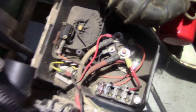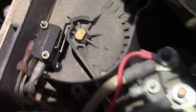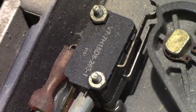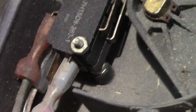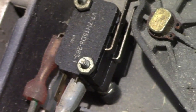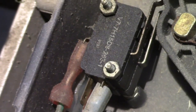Alright, we've got the cover of that fuse box removed and we can see our micro-switches right now. Just going to zoom in on them — there are just two small machine screws holding them on. You remove those two nuts, and I would recommend that you remove the top one first, then unplug these wires one at a time and plug them into your new switch as you go along, that way you won't forget which one goes where. So we're going to take the nuts off, remove that top switch, unplug the wires from the old switch, and plug them onto the new switch.